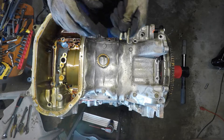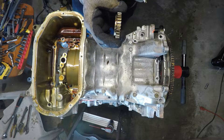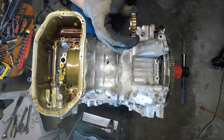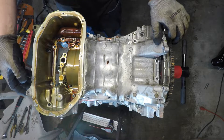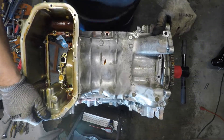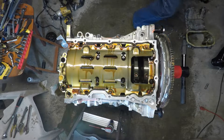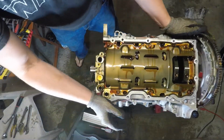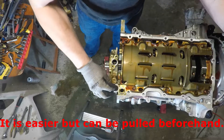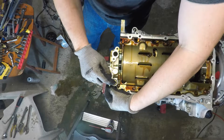Keep in mind these three are for the oil pump. This is the main gear that goes around the crankshaft. Make sure this shoulder goes towards the outside of the engine — no shoulder in, shoulder outside. Once you separate the upper pan from the engine, then you can pull the oil pump completely. And there's an O-ring here as well — this may have been overlooked at some point, but you have to have this O-ring here.